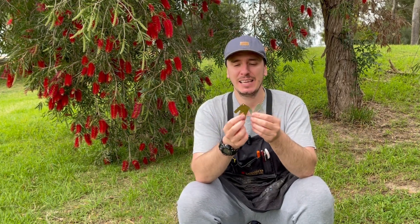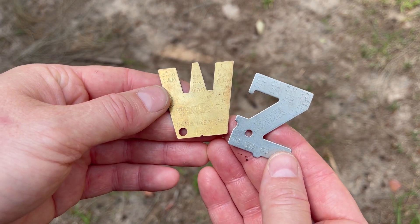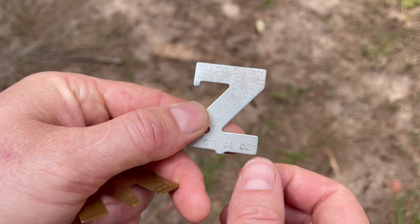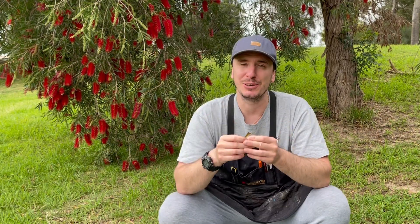What you'll need to be able to measure the height of the lever are metering gauges. They're just stamped pieces of metal supplied by the manufacturer of the carburetor that you're working on, and you'll find across them the different models of carburetor that you can use to set them. Each carburetor is different and each manufacturer has a different set height, so there isn't one measurement across the board that you can use.